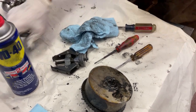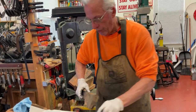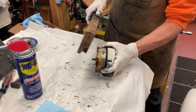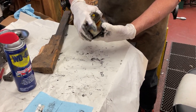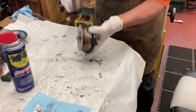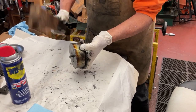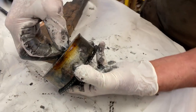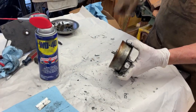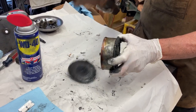Now what you do is get a piece of pine — you can use a two-by-four. I just made this out of a piece of oak years ago. You're going to hit it at a 45-degree angle, just like this. Walk it around. Now you can see right in here the plate's starting to move. You're going to hit it at 45 degrees like this.